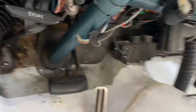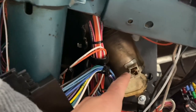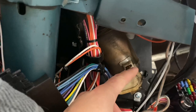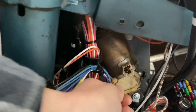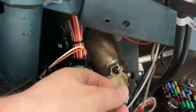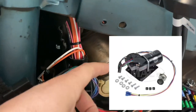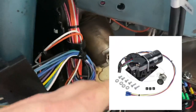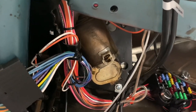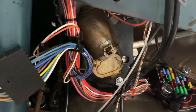If we hop up in the car and look underneath the dash, this is your wiper motor right here. The single speed will have three male spade connectors that you would put a female plug into. If you have the two-speed, you're going to have a pigtail that comes off four wires — this one is only three. So that is, as far as I can tell, a great way to determine whether you have a single speed or a dual speed.